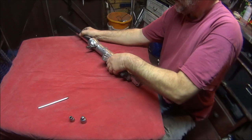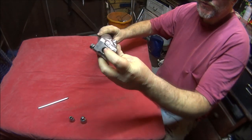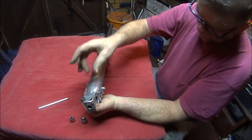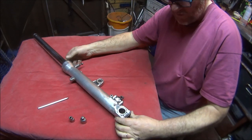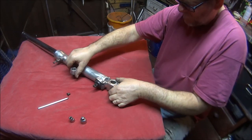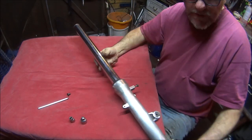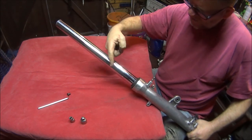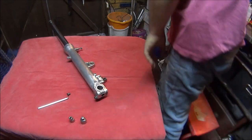So where I'm going to start on the other fork — I did start by taking the top cap off, as you probably saw in the other video. But with this one we're going to do the Allen bolt first. There's a little Allen bolt that lives inside there which holds the damper rod thing inside. And if you've ever tried this before, they can be very difficult to undo because they just spin round inside. So you have to take the top cap off anyway. In this case with the CBR, I think you have to get a broomstick and knock it down into the dampening rod. Let me just show you the other damping rod.